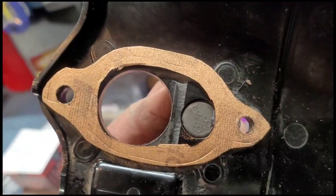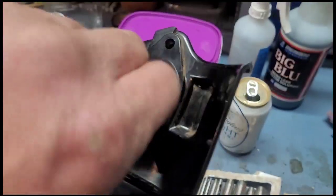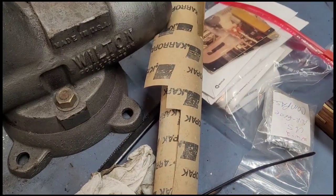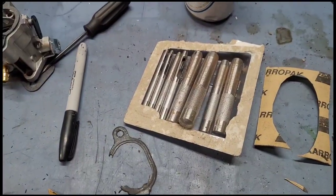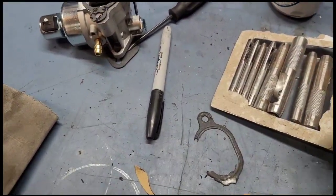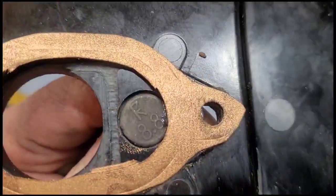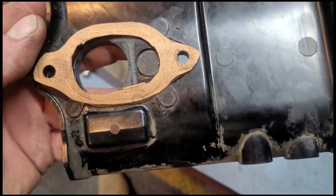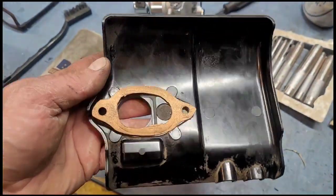Got the gasket made. While it's not pretty, I don't care — the important thing is it sits on the seal and doesn't block the port. I have some Permatex copper spray gasket that I laid on there. This gasket material is from one of the big parts houses — O'Reilly's, Advance Auto, AutoZone, whatever you have near you. I've got some inexpensive gasket punches; the nice ones I had got dull from use. I put a little dab of black RTV on the side where the stud is, just to hold the whole carb stack together during assembly.